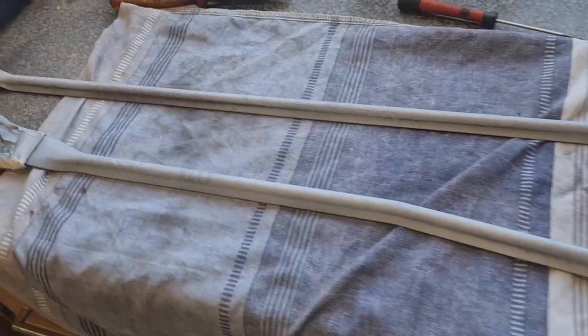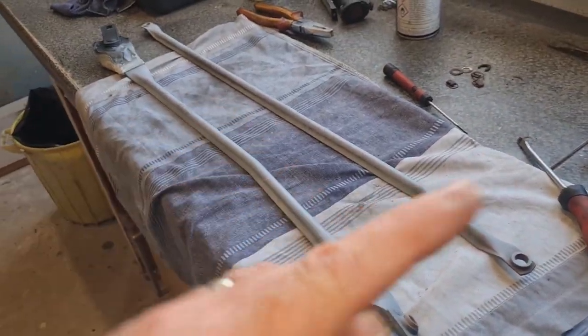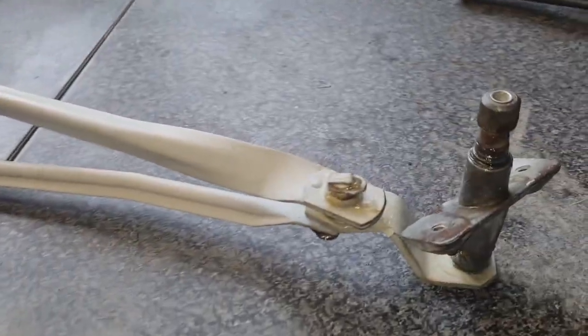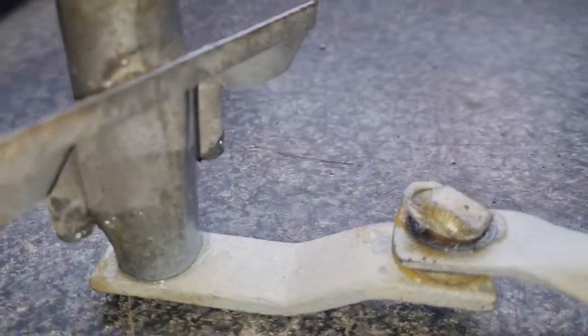I've given them a quick prime-up, just so they've got a bit of primer on them, both sides on both of them. What I'm going to do is paint these with the white stone chip that I've used in the scuttle — that way they won't show up through the scuttle bars and they'll be invisible. An hour and a half later and she's done. I've painted it all up nice and white, nice and clean, and everything is all greased up and ready to go back in. Down the bottom there and up the top, that is full of grease. So everything's all done and ready. Cup of tea time, and then we'll put it back in.